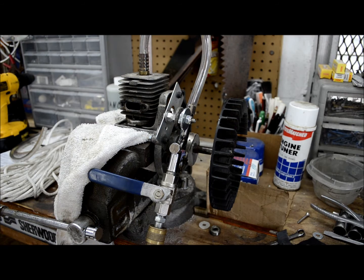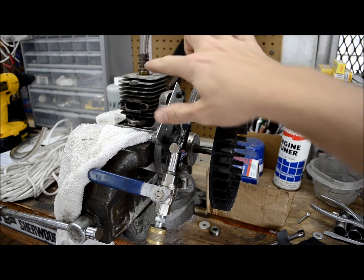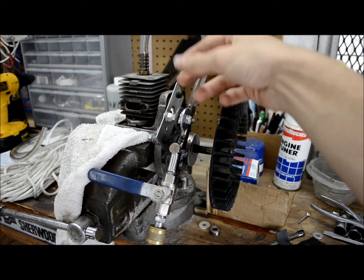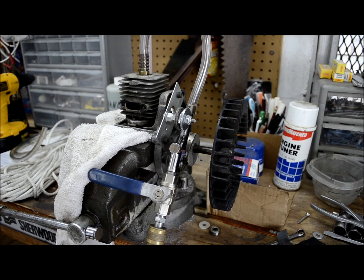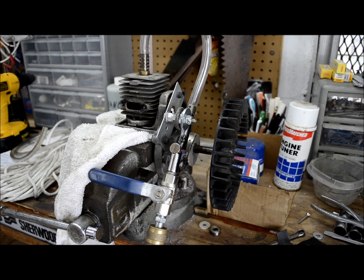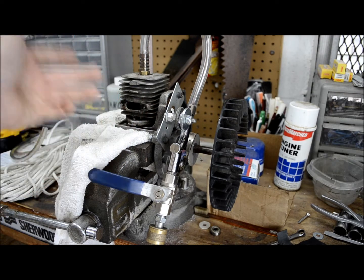As you may know, this engine uses pretty much an identical design as my first one. For this go around, I wanted to try something a little different. Since the spark plug hole was directly on the top, I tried making a little check valve that went straight into the top, connected so the piston would hit a little bolt that opened and closed the check valve at the top of every stroke.